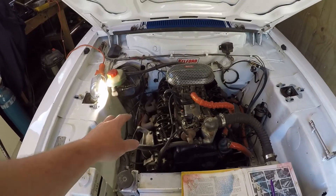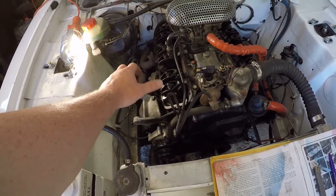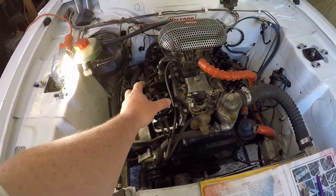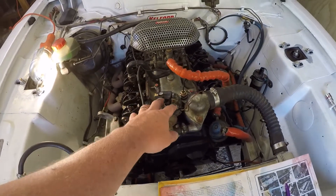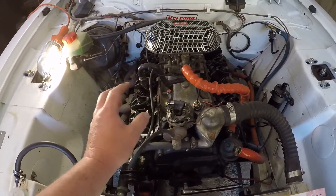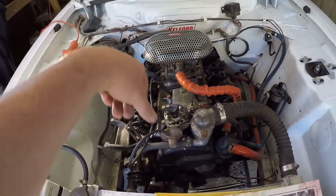For this job I've removed the alternator — that's the alternator bracket here, so that's gone — and that was so I could get my valve cover off on this side. Also had to disconnect that breather. I've just taken the distributor cap right off, so when I put it back on I've marked number one lead and then I can just reset the firing order.